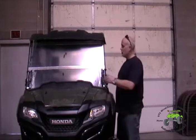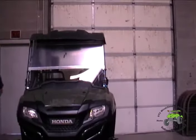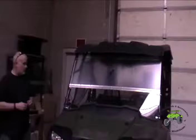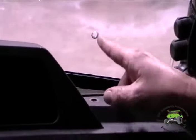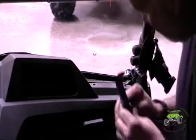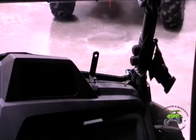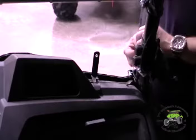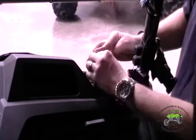Now that I know this windshield fits, I'm going to put the dash brackets on because they help in lining everything up. We're going to take this plastic grommet out right here — it lines up with this hole. Then we feed our little plastic grommet back down through there. It's a little bit easier to put that in first and then shove it down. You see how it just popped right into place? This gives the windshield additional structural strength.